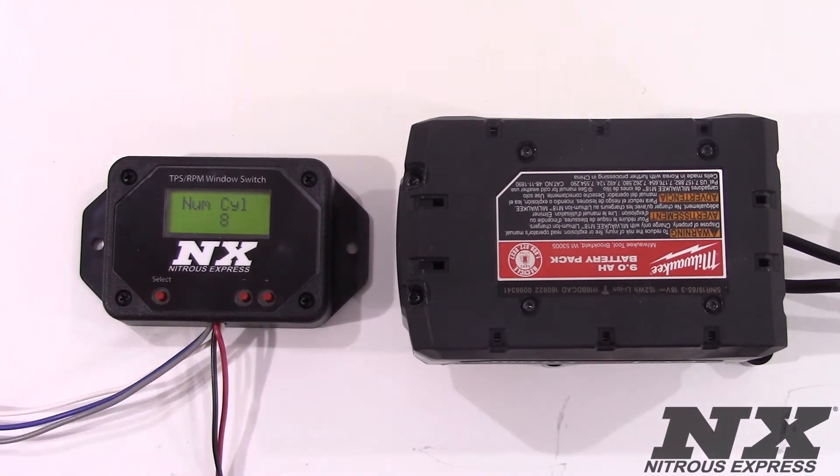This next screen is the number of cylinders screen. This will need to be set using the determined number of sparks per revolution from the type of ignition system fitted to your vehicle. For vehicles with coil on plug style ignition systems, it is not uncommon to have to set the multiplier for 1, 2, or even 4 cylinder mode to get a correct reading. When choosing the number cylinder setting, always verify the setting with the tachometer in the vehicle to make sure it is reading correctly through the entire RPM range.